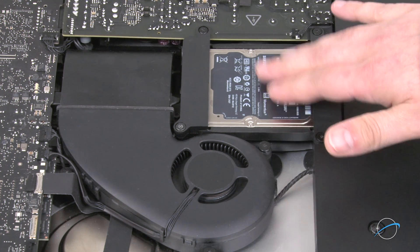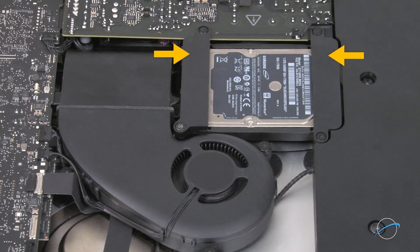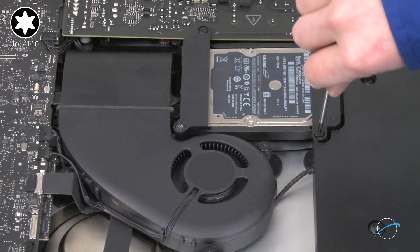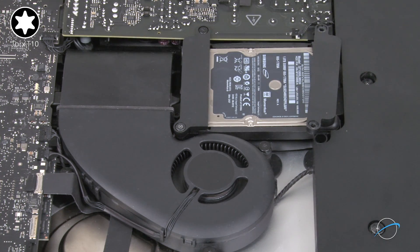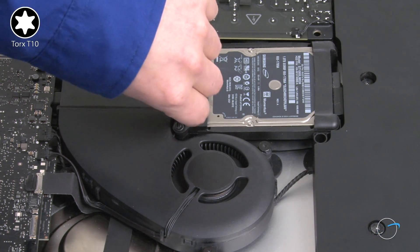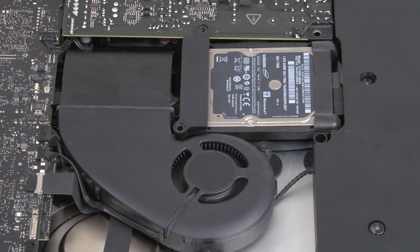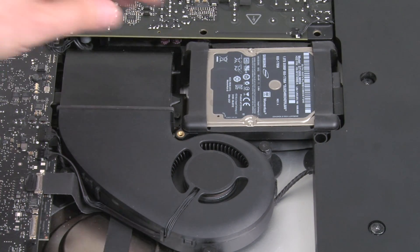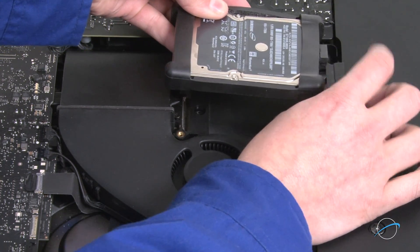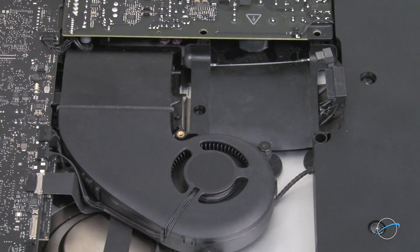The hard drive is located here. To remove the hard drive, we first need to remove these retainers. The retainer near the speaker has two screws that are the same size. The retainer next to the fan has two different size screws. You can then lift the drive out of the bay, detach the SATA cables from the drive, and remove it from the iMac.